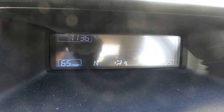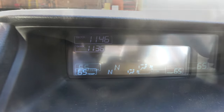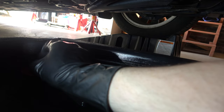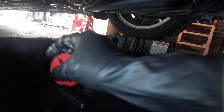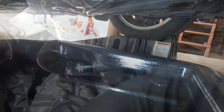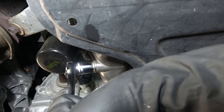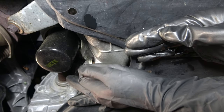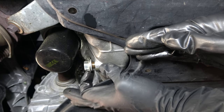We start the car at 11:36 and turn it off at 11:46. Obviously the garage door is open and we have good ventilation — make sure you have good ventilation before you do this. Now we're going to break the drain bolt and let the engine cool for about 20 minutes before we drain the oil, or it'll be too hot.